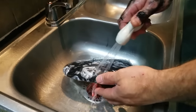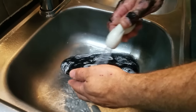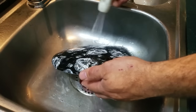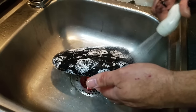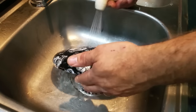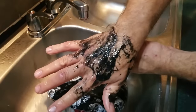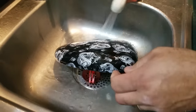We're inside now, heating up the water and using the sprayer to rinse off the gloss. The initial gloss you get when you pull it right out of the dip looks really nice but it needs to be rinsed off — it's actually the film residue. If it feels slimy and sticky the film is still on; you'll know you got it all because it won't feel slimy and sticky and it'll be dull. As a side note, it's probably good to wear gloves for this step — he's got a black hand right now, it won't hurt you but it's extra work to get off.